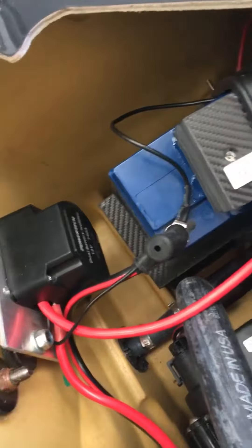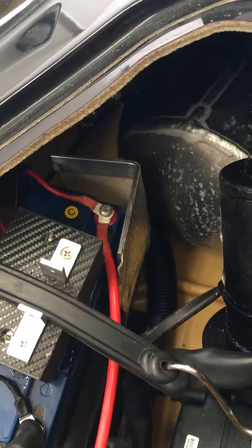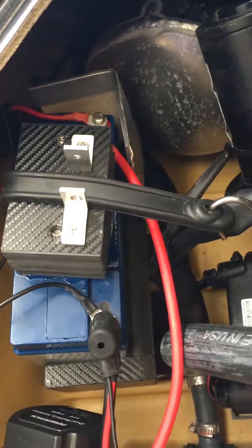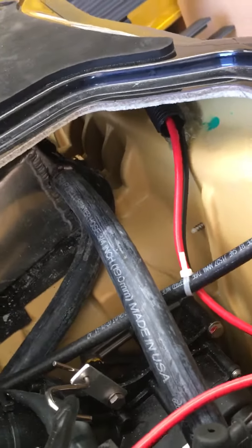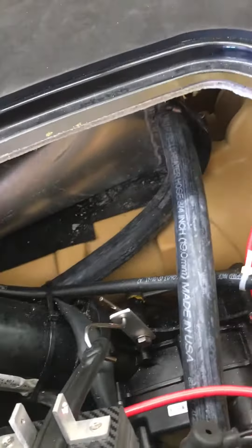Heading to the back of the ski here — as I showed you before, this is the original battery setup, and then we look at the dual battery setup here with the waterproof isolator. All the cabling in place, heat shield, easy access, everything's serviceable. 22 amp hour gel deep cycle battery which runs parallel when starting. The cables run up through the other side of the ski there.